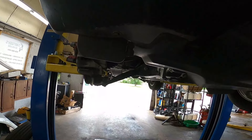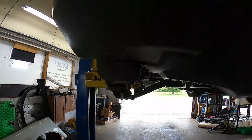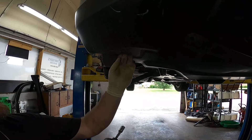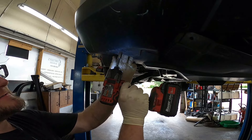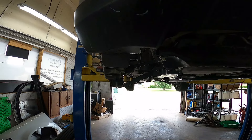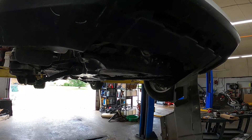Also right here, there's a little 10 millimeter bolt that's actually pressing these two covers together. Go ahead and remove that 10 millimeter bolt, and we now have all the access to the AC compressor that we should need.